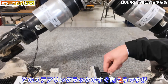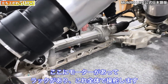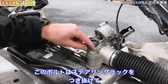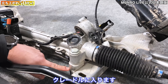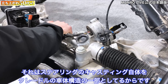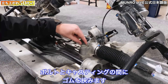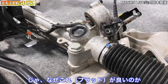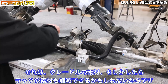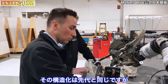We also saw changes in one of the back cross members of the cradle. On the steering rack itself — the motor, the rack, everything that steers the vehicle — you've got an input from the i-shaft here, and this is hard mounted to the cradle. The bolts go through the steering rack and into the cradle. The reason hard mounting is significant is that they're using the casting of the steering rack as structure to the cradle. If you don't want to do that, you'd put rubber between the bolt and the casting — what we'd call isolated mounting. In theory, if executed well, you're taking material out of the cradle and potentially out of the rack because they complement one another's structures.